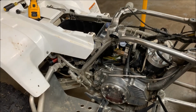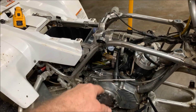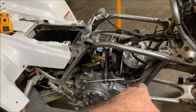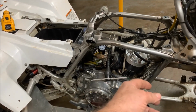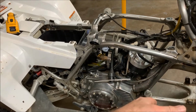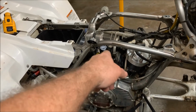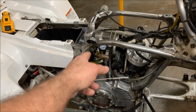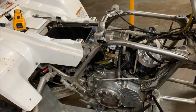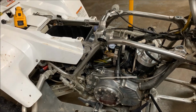So it's the same principle for all the different kits, even a blaster. You got one carburetor on a blaster, and you got a different type of exhaust port on the blaster, and it takes an internal rubber expansion plug. You put that in there, tighten it up, put your piston down to bottom dead center, stick your gauge in, pump it up to 6 or 7 PSI, same test. It's a leak down test. It is a big deal, but it's not that hard to do.